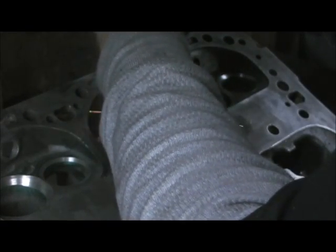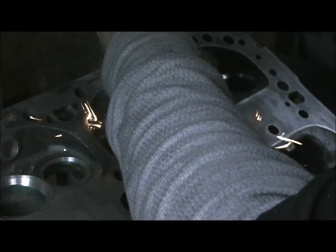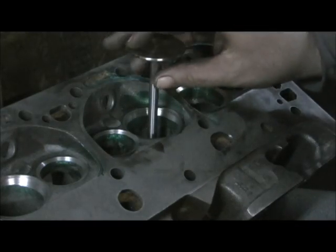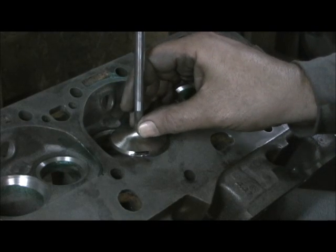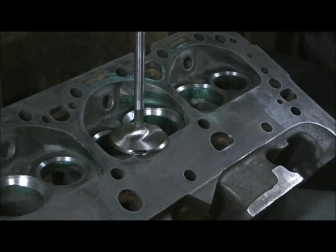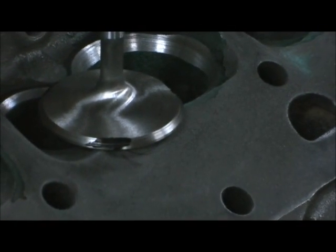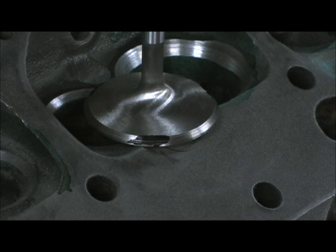Let's see what we've got. They do bounce it a little bit — when you really get the guides in perfectly straight and true, that's what you get. Now that's what I'm looking for right there. It's right now about 10 thousandths or so from the very edge of the valve. So the 60 and 30 — I did the 30 first, then the 60 — comes to a point. That's the point you mark on the valve, and what that does is place the seat in the correct position.